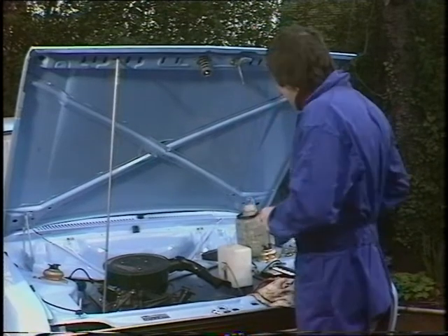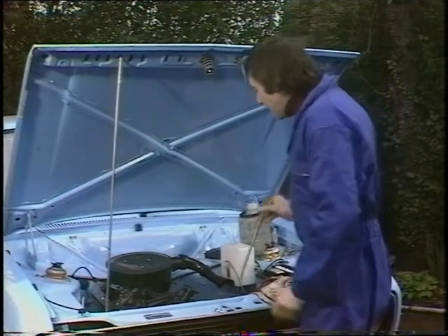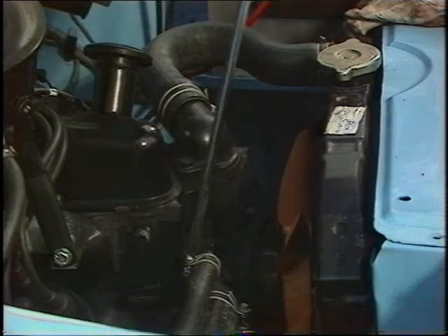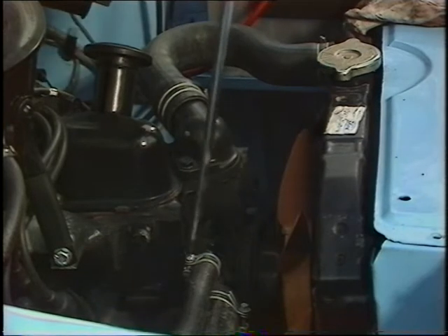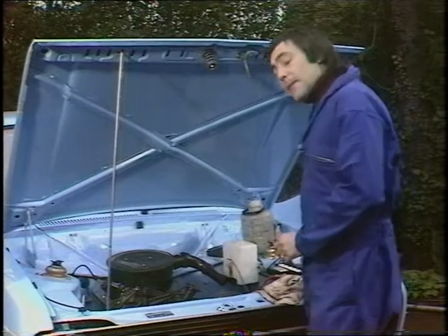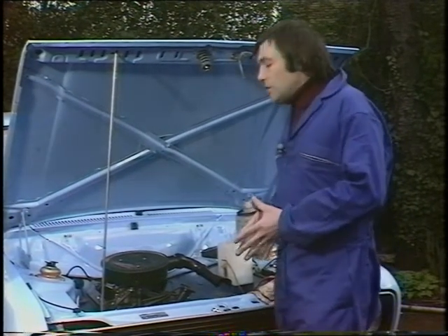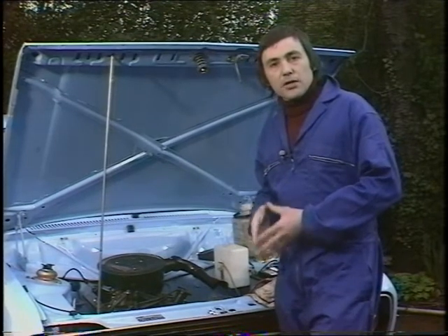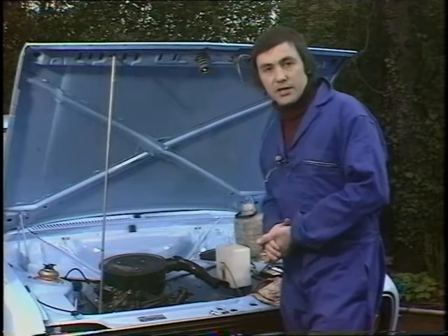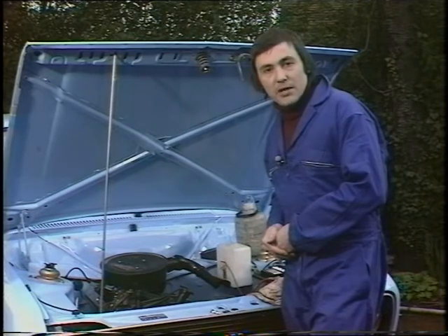Or of course you could be losing coolant through a simple leak. The motor car engine has a myriad of hoses and clips, and one of these may well have come loose. If so, tighten it up, but not so much that the clip cuts right through the hose. If any of these things happen to you out at night on the motorway, most motor engineers do not advise the use of those patent coolant sealing products — the things you pour into the water system — because at best they're only very much an emergency get-you-home measure.